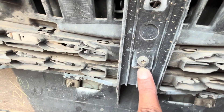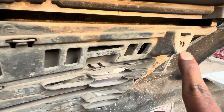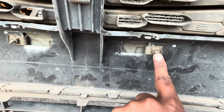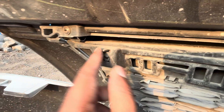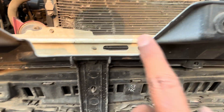This one is the left-side and right-side fog lamp assembly. This one is the central grille - the grille is fixed completely with snapping using snap features. All are locked with snaps. Next, the upper grille is again snapping. These are the snapping features with locators in the middle and screw fixation, so the grille is fixed to the bumper from the back side with screws, guided with star or cross locators, and fixed with snaps. The rib is the guide and the screw is the fixation. For the number plate, C-clips are used with screws, and this side again has guiding and fixing purpose. The upper side fixation has a recess given for the bonnet assembly.